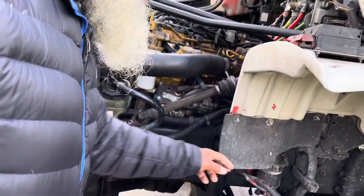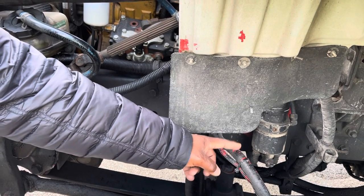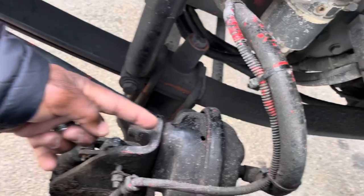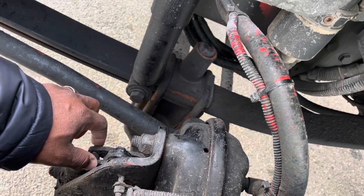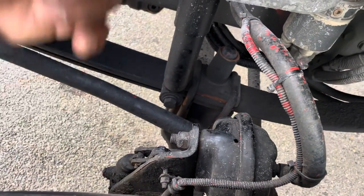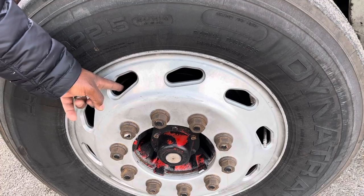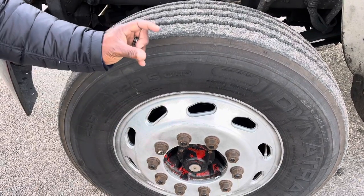System number two — the braking system. I have the ABS line and the brake hose. They're not cracked, not broken, and secure — not dry, rotted, or frayed — with no leaks. The brake hose goes to the brake chamber — not cracked, not broken, and secure — not dented, with no leaks. The push rod and slack adjuster go into the brake chamber — not cracked, not broken, and secure — no illegal welds, no loose or missing parts — at a 90-degree angle. When you pull on it by hand, you should not be able to pull it more than one inch with the brakes released. Inside the wheel is my brake drum — not cracked, not broken, and secure — no dents. Inside the brake drum are my brake shoe lining — not cracked, not broken, and secure — no illegal welds, no loose or missing parts — and not worn dangerously thin.